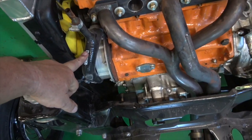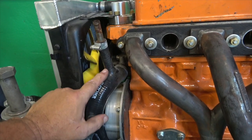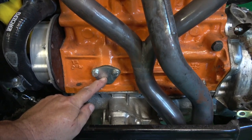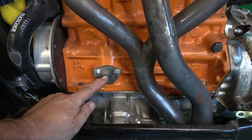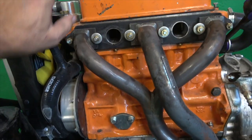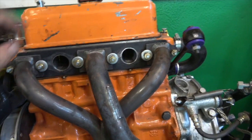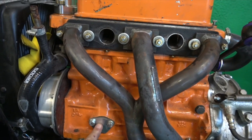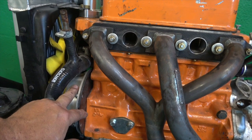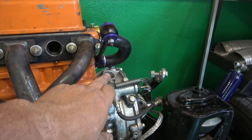We're going to change the lower radiator hose — this one has the heater tee off it which we obviously don't need in a track car, so that's coming off. This port is for the mechanical fuel pump, but ours is electric, so we'll take a breather from here and come up to attach it further up. The new rocker cover from Tonic's Way, due Monday or Tuesday, has two breather pipes on it, so it'll be breathing from the crankcase. There isn't one on this SNH belt timing cover, so we'll have one coming up from there and more coming out of the clutch housing.